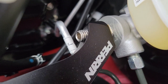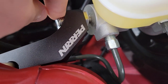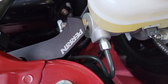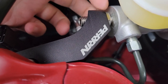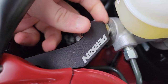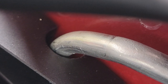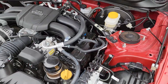Once you get this in there facing the right way, tighten it down and get this screw snug with the master cylinder brace. Bring the lock nut to where it's got a little bit of pressure, do one more solid turn on the other side so it's nice and tight, then crank down that lock nut. When you're all done with that, you're going to have to bend the hard line out of the way so that it clears perfectly — it says that in the instructions, so just make sure you actually do it.